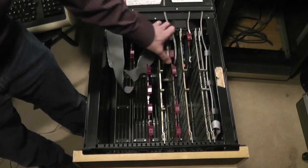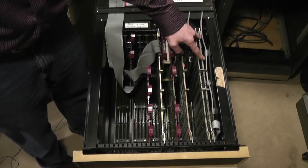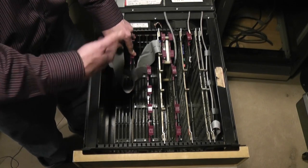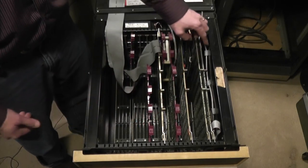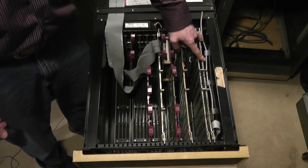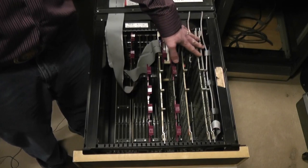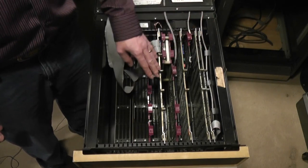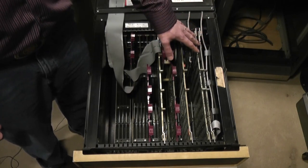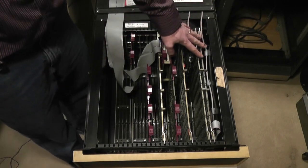After those first two CPU slots, we have what are called the unibus — the PDP-1134 is a unibus machine. There were PDP-11s of both this variety and a Q-bus variety, as well as larger machines with other bus types. One of the interesting things about the PDP-1134 is this unibus, which is the processor bus that communicates between the processor, memory, and all its peripherals. The 'uni' in the name is of course 'one,' and the interesting thing for the time was that there was only one bus in the machine — the processor, the memory, high-speed peripherals, low-speed peripherals, everything the processor talked to all went on the same bus, rather than having separate buses for each.